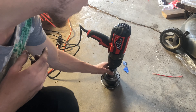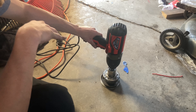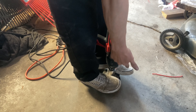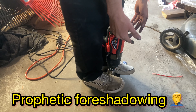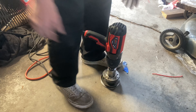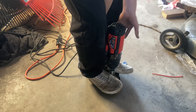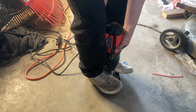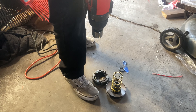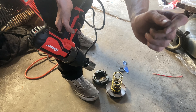I'm back with the right size socket. We're going to get this nut off. For me, the easiest way I found to do this is to stand on top of it, because that contra spring is going to spring up as soon as you get that nut off. So if you put your body weight on it and then get it off, you can slowly step off and remove it. Well, that freaking hurt — I didn't keep my body weight on it and it popped up and smacked me in the thumb.